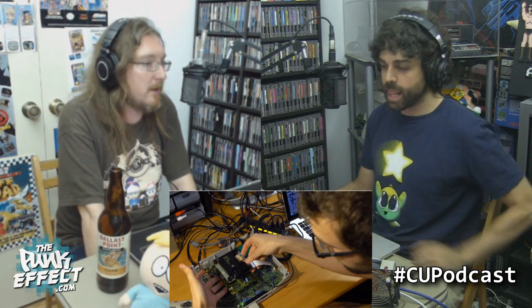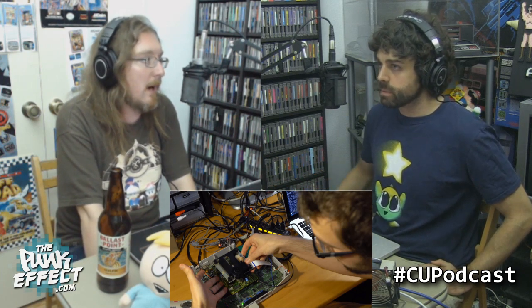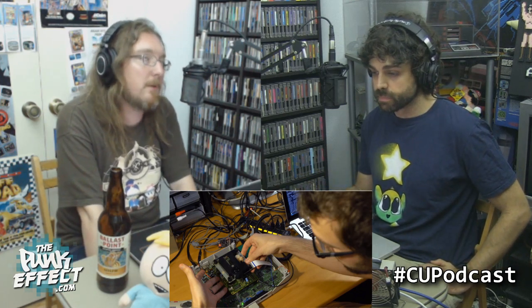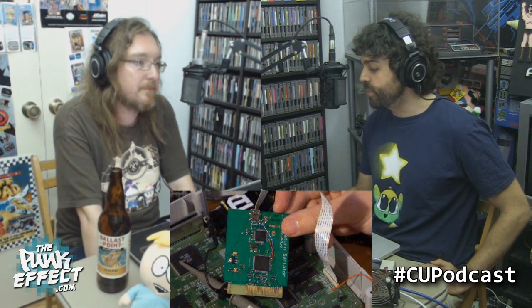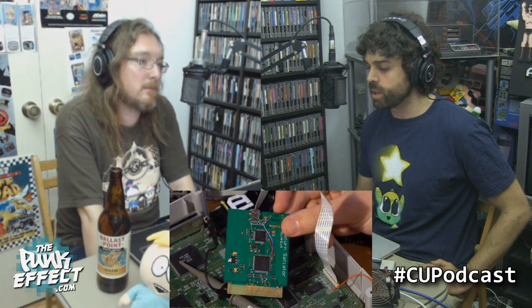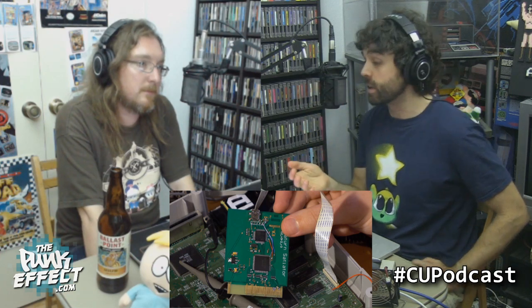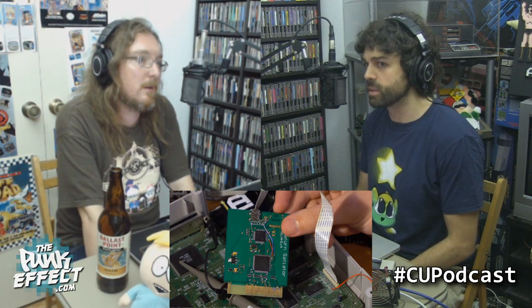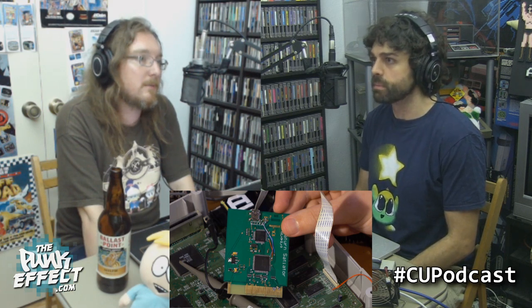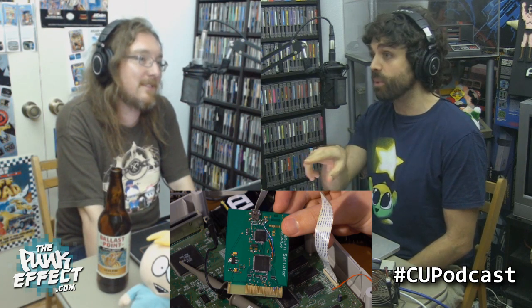Through examining and exploiting the VCD port, he found a way to create a card that uses a USB drive to load ISOs directly into the part of the hardware that reads the data. He figured he'd try to go through the normal routine and find where he could shut off the protection in the Saturn's main processor, but he couldn't find it. Then he realized: something in that VCD decoder card must be able to shut off the protection, because video CDs don't have that wobble. He went into that and said, now I've got it.